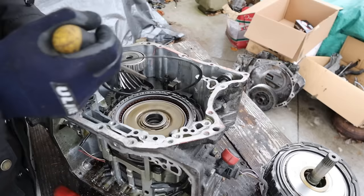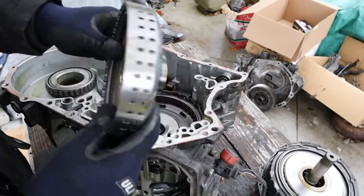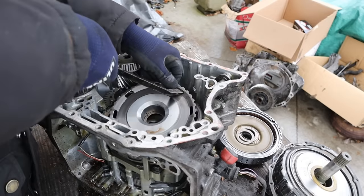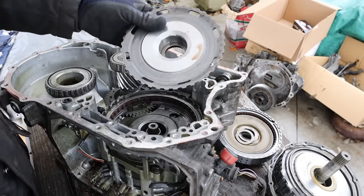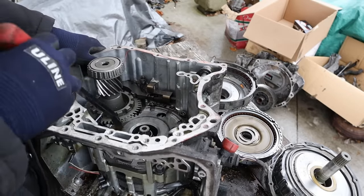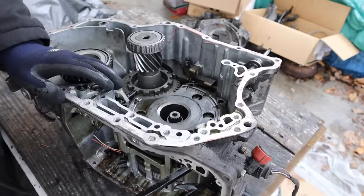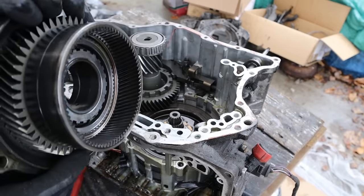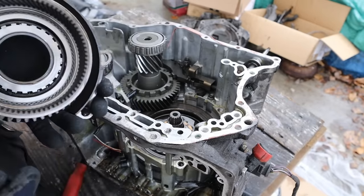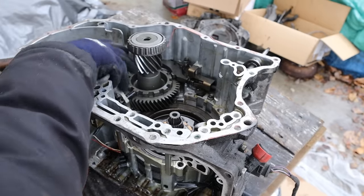This is our first set of clutches — it's a snap ring with no ends. This next guy is basically nestled inside of that one; there's a washer in here. Next set of clutches. Looks like we've got a plate here that's bolted on — I'll remove the torx bolts holding this plate on. That kind of looks burnt up, a little discolored there. And it's got the ring gear of one of the planetary gear sets in it, which directly drives the counter gear over here, which will drive the final drive.